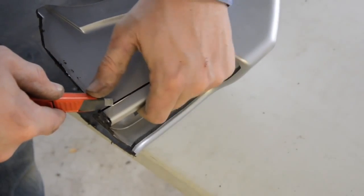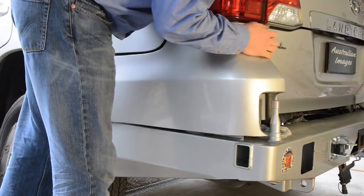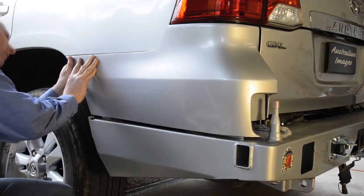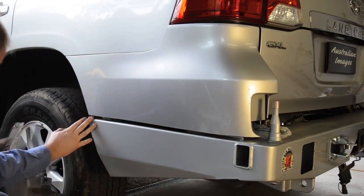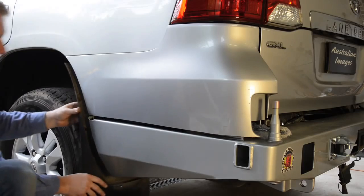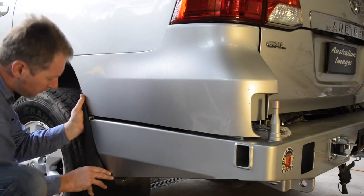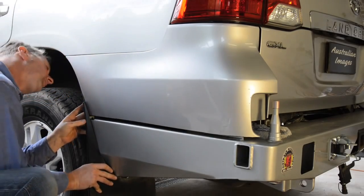tool or die grinder. Moving back to the vehicle, test fit the plastic bumper wings, ensuring that the wing cut is parallel to the new bar. Recut the wings if required. Then test fit the mud flaps, checking for a smooth curve along the mud flap between the new bar and the guard. If required, space the new bumper back from the chassis using the large included square washers.